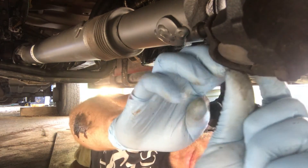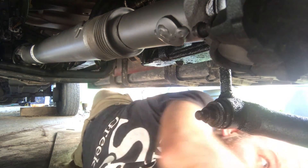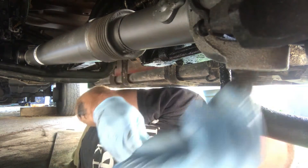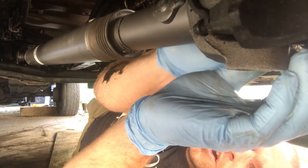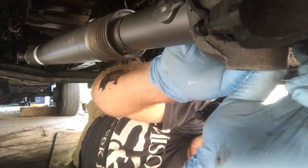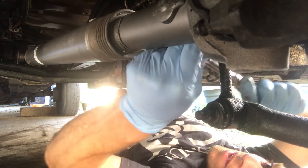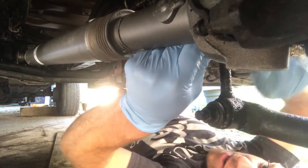It's all sorts of nasty under here because my oil cooler is still leaking — you can see that nice big smudge on my arm where I accidentally touched the underside of the frame. That day I went to pull the drive shaft off, it wouldn't turn because the front axle was in a bind due to some hubs I'd put on about a year ago. The hub and bearing assemblies were the wrong ones — not the proper fitment even though the website said exact replacement part. So for a year, my front drive shaft has been spinning even though I've been out of four-wheel drive because those hubs had the axle in a bind.